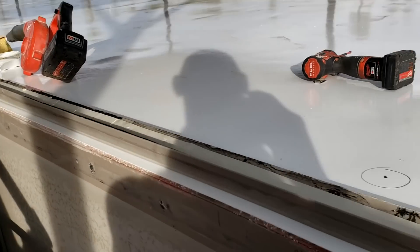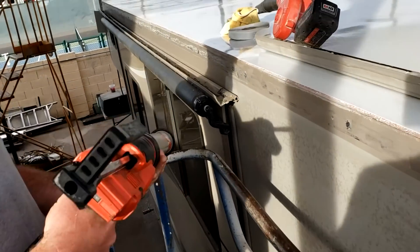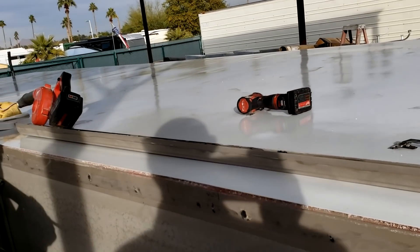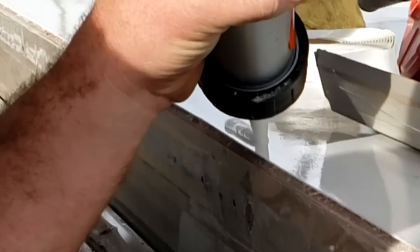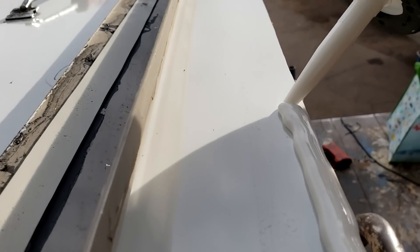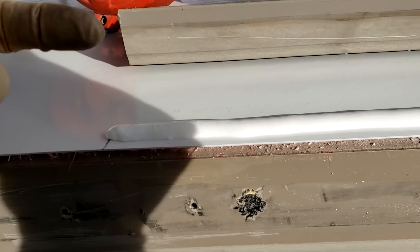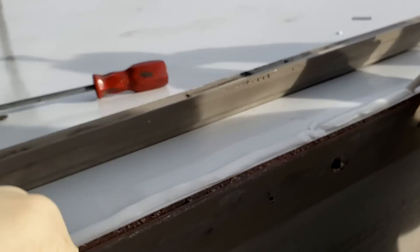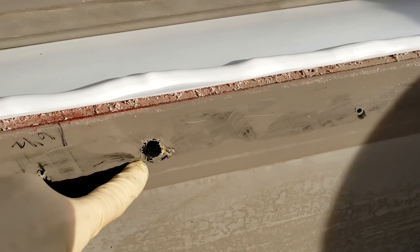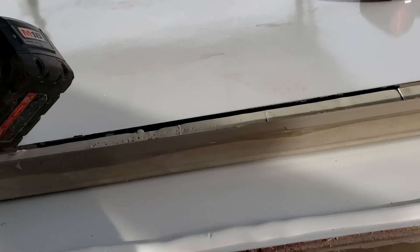We made a mark down there — we're going to put the silicone on the roof and then put the molding on top, all the way down. There are four pieces of trim on the roof. The silicone will act as adhesive and as a good sealant, keeping water from getting down through to the sidewall. Since there are no screws actually holding this down, it's all just clamp force from the molding screws — and that means no holes going into the roof.